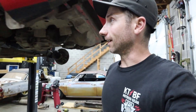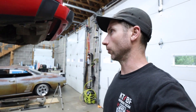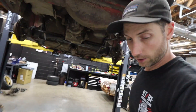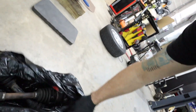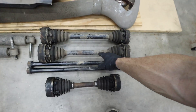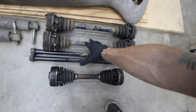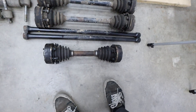The rear end is in the 924S! Elliot said it was the hardest part of the whole deal trying to get that thing in, and he wasn't kidding. All I have to do now is get the short axles in. You can see here the difference in lengths on the axles — these are late track width. The later model 944 track width is much wider, which means it needs a longer axle. This track width is much more narrow, and that's the difference in axles.